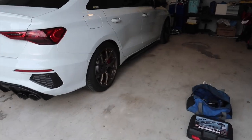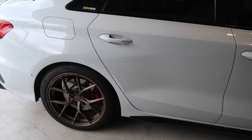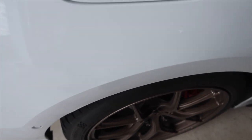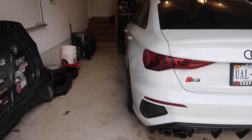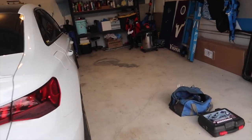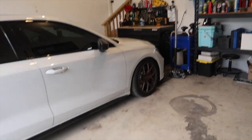She's back on the ground — we're gonna go drive it and make sure everything feels decent. The car looks jacked up right now because it hasn't moved yet since being on stands. I think I had it set at negative 2 or negative 2.1 with like a tenth inch of toe. Come tomorrow I'm going to zero the toe front and rear, put the rear camber at negative 2 degrees, and leave the front camber where it is — we'll be adding about 1.4 to 1.6 degrees with the 034 camber mounts going on the front.